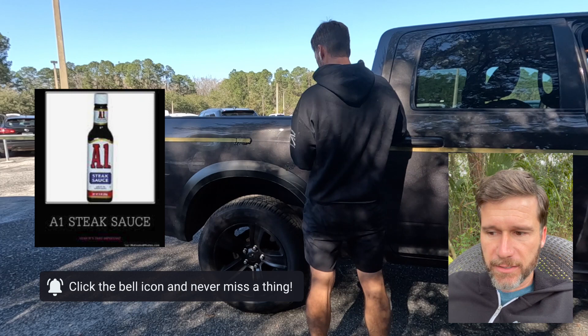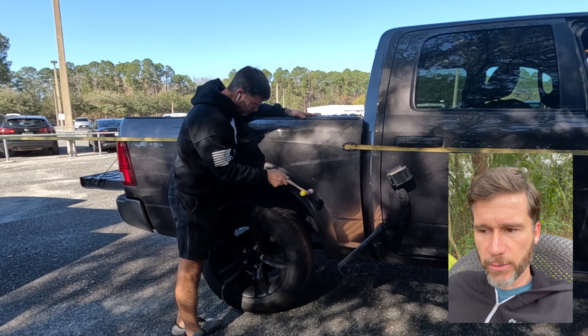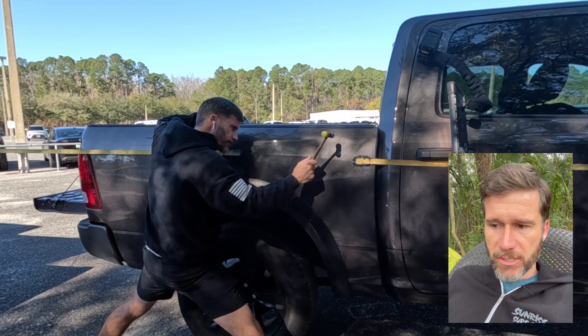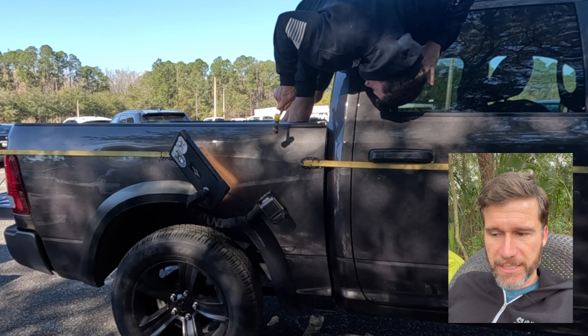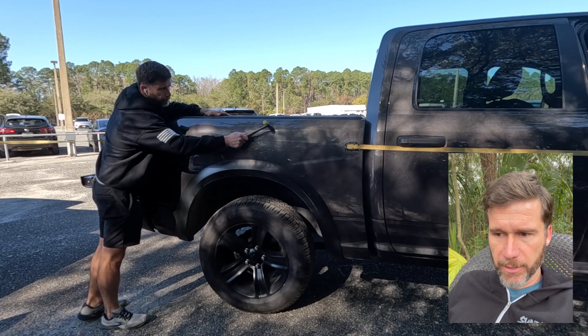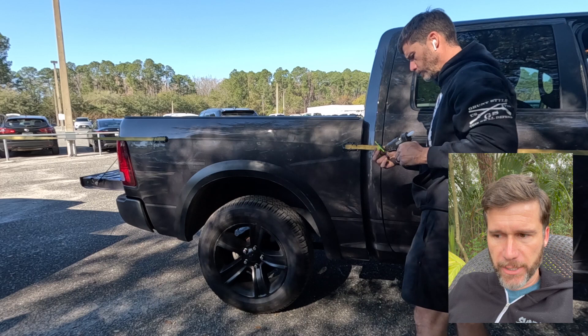There's a big area of smile down at the bottom that I'm releasing. That tension is helping pull the dent out as I'm knocking down those big areas of buckled-up metal from the damage. I'm still working that smile with that hammer. Now I'm moving my strap to the back so I can work on that area, and now we're going to do some actual hot glue pulling.